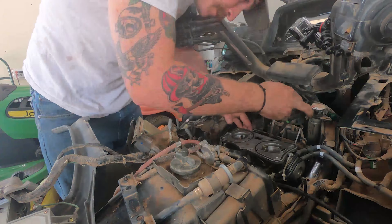You know how I just said to buy some of those different needle nose pliers? Well, for this piece right here you're really going to need them whenever you're putting the air box back on. That hose that I'm touching right there — and there are also two more hoses in the front — all of these have to go onto the air box.